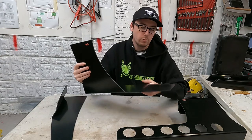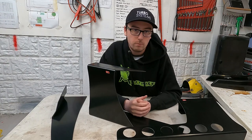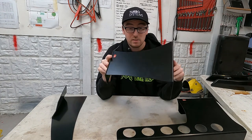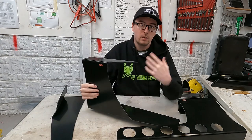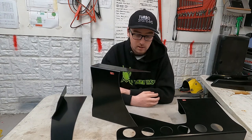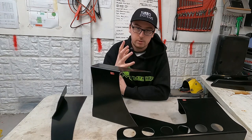That's probably one of the biggest things about adding aerodynamic parts to your car — there's always that worry that they're going to fall off and break into pieces. These are made out of plastic, not fiberglass. So when they do get hit they will take a bend, they will probably bounce off and keep together as one piece. Unlike fiberglass parts that when they get hit they crack, they snap in half, and they're kind of scrap after that. We'll talk about the fiberglass and plastic situation a little bit more later on.